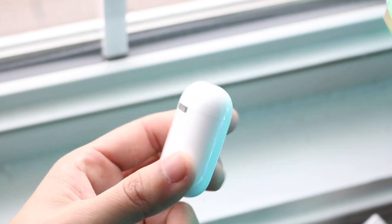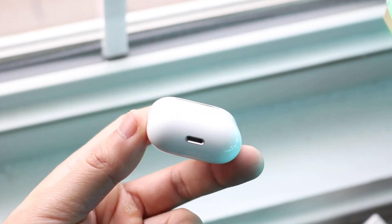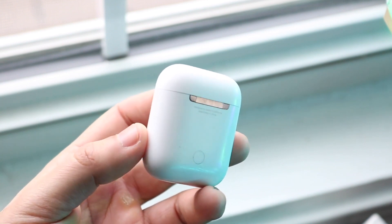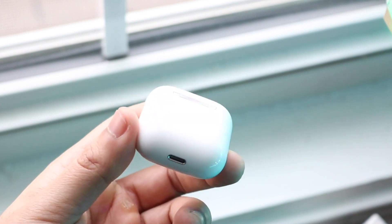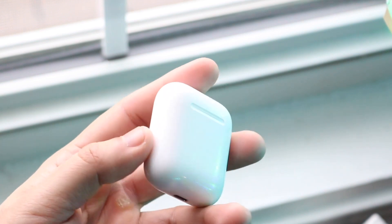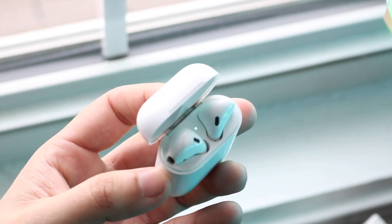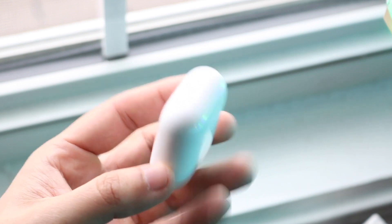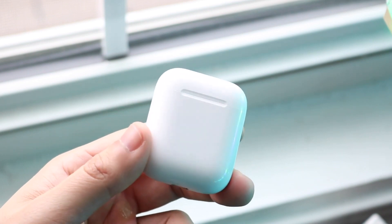Now if it's the AirPods themselves that aren't charging, the main thing to look at is whether it's a battery problem or a connection problem. You have to remember that when you put your AirPods in the case, things on the bottom of the AirPods can cause problems. Just like the lightning port issue, sometimes there can be a lot of earwax buildup — I know it's disgusting — along with dirt and debris within the case or the bottom of the AirPods. So take your AirPods, clean them out on the bottom, clean them out on the inside, plug them in, and go from there.